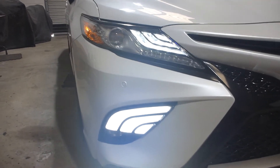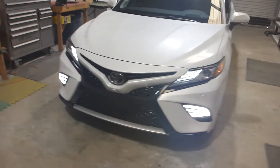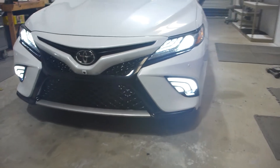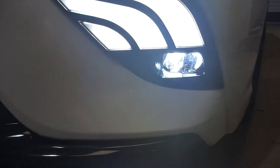It's the slightest bit warmer than the OEM — a little bit warmer there. However, it looks just fine, and as far as anybody else is concerned, it matches the shape and it lights up, and that is the intention. I wired the actual fog light assemblies down there into the headlight circuit, so anytime the headlight comes on, those fog lights underneath will turn on as well.